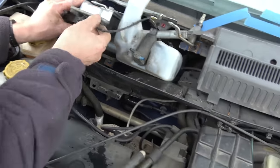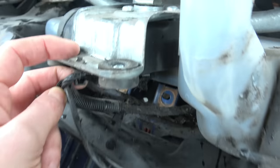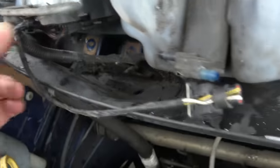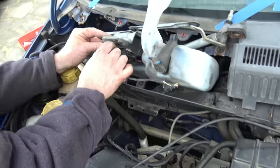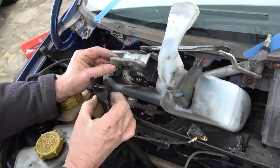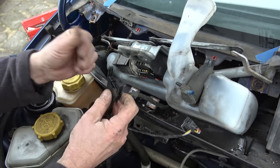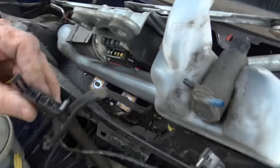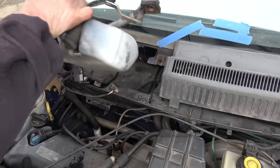Now it's just the connection to the wiper - here we go, there's a little multi-plug here. It is cable-tied on but not with a reusable cable tie, so we're going to squeeze this and push it back through. It's a multi-plug - with a bit of force it has come out; it's not really made to be taken apart. The plug itself was easy. It's quite wet in there - but that looks like electrical grease, not water. Yes it is grease - electric grease. Good.